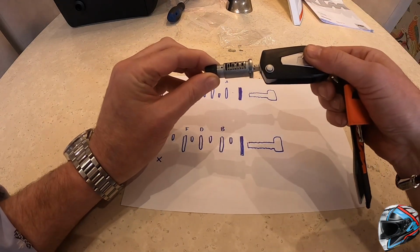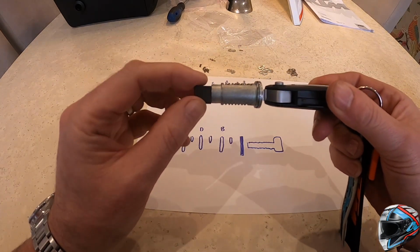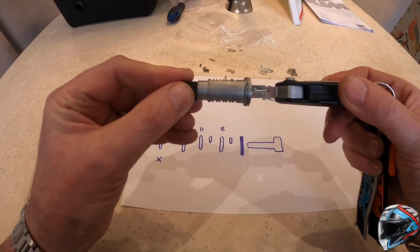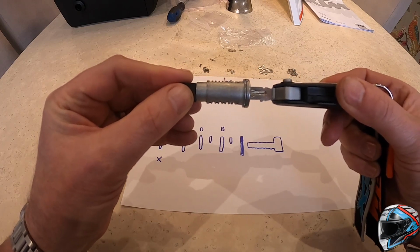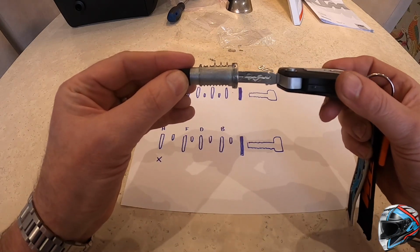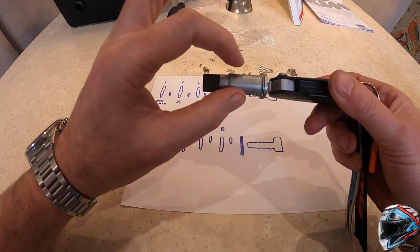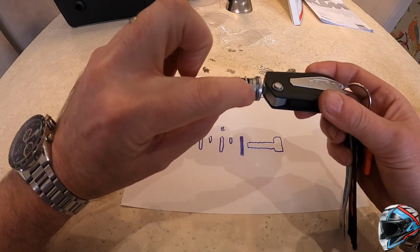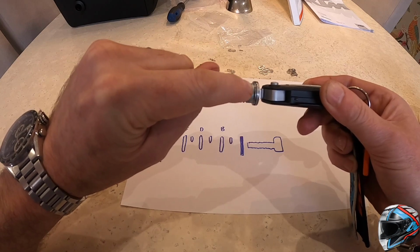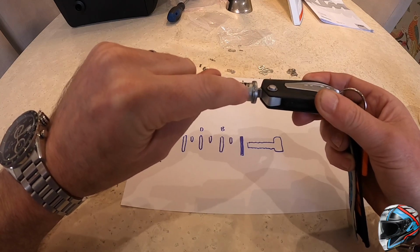and you put it into the barrel. Now hopefully you can see that as the key moves in and out, those shims move up and down to reflect the recess in the key, which is unique to you and your bike. So by putting the key in all the way, you'll see these 3 shims are elevated by different degrees. The one in slot A is flush with the barrel. So what we know now is that that first shim is correct, i.e. number 1 in slot A.